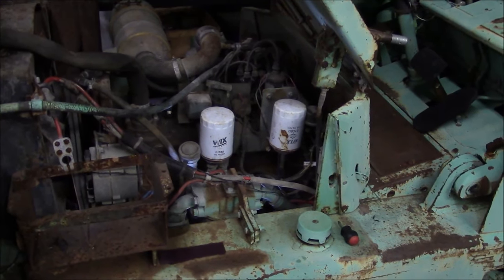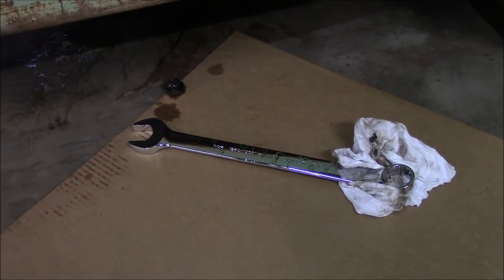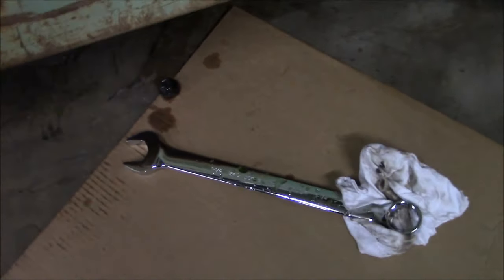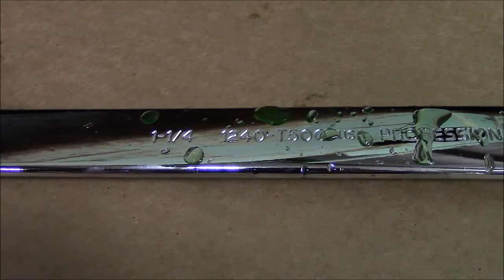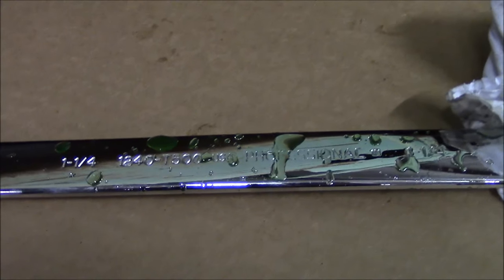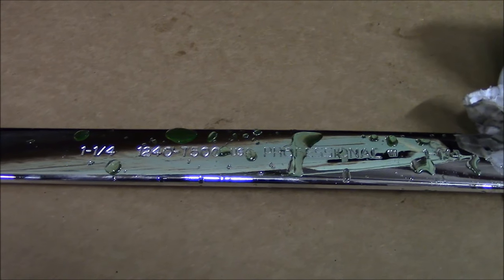Still need to get a battery, filters, etc. The problem is I dropped the oil plug out of the bottom of the pan to drain the oil. You can see that green fluid on my wrench — that is coolant. I took the drain plug out and got about two gallons of coolant out of the oil pan. I pulled the dipstick and it was way over full.